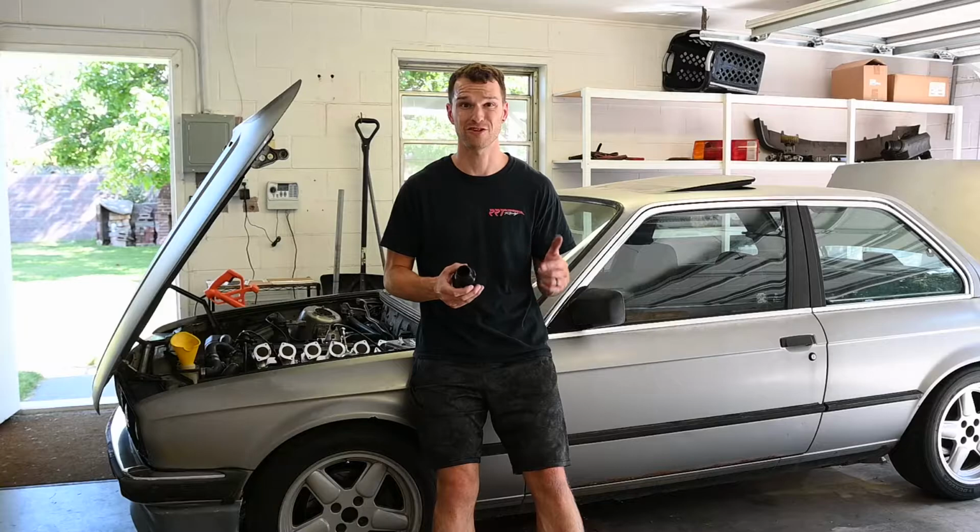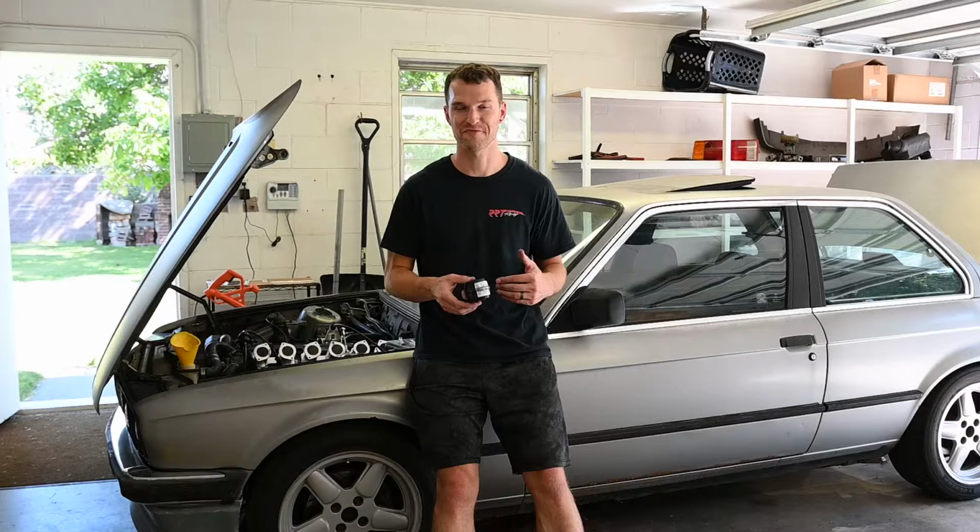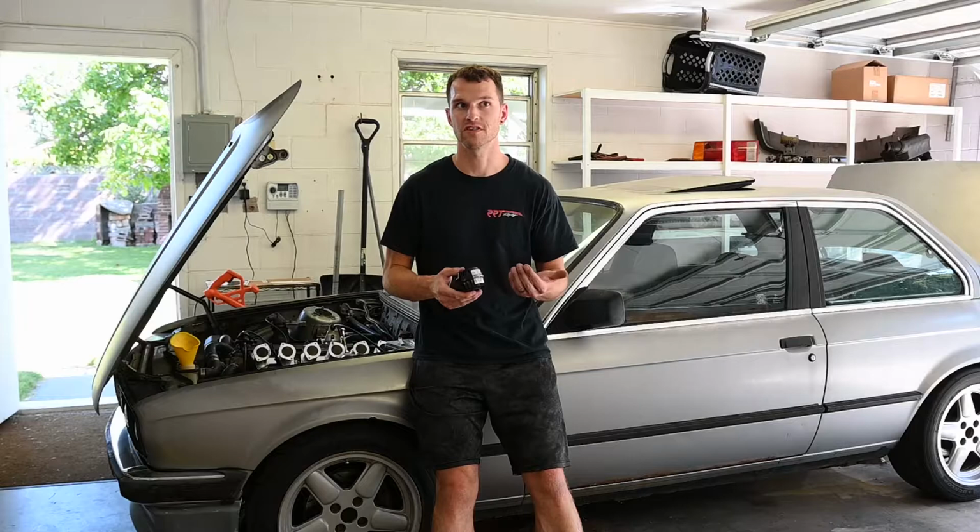So that tells me that our middle set shouldn't have been pulling as much air as it was. So I have to go back to that middle set. Maybe the set screw on that one needs to be adjusted out to allow the middle set to be closed a little bit better to begin with, and then we'll be able to sync to less air.